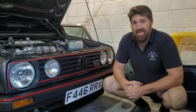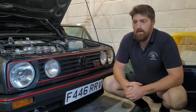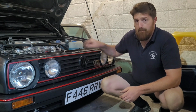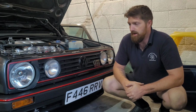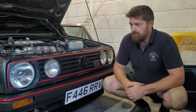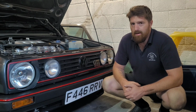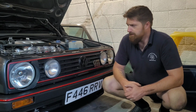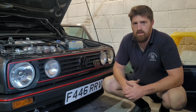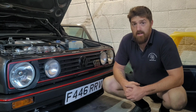So what's next for this? This is going to go on the rolling road again on the 2nd of September, booked in for. So a couple of days after that we should have a video up of hopefully that popping out over 180 brake. It's flying at the moment. We see from the last videos it's not hanging around. So we're happy with everything. All we're going to do is add a bit more ignition timing in. It's on about 9.5 or 8.5 at the minute, so we've got that by a good 2 degrees, see how it's running, listen out to what we're going on with, and then get it on the rollers and see what it does.